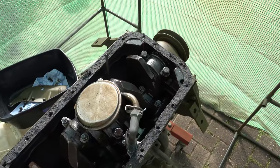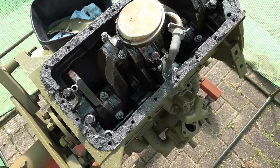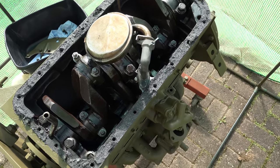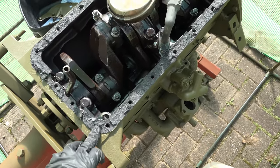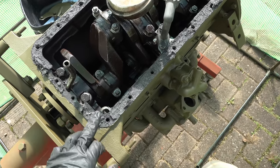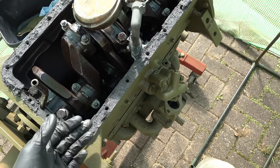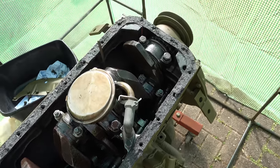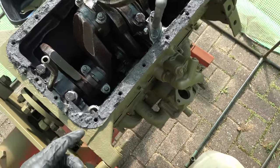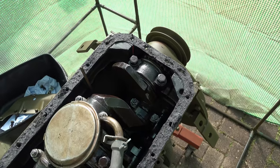It's hot in here today, hotter than it was a couple of days ago. We've got to keep this clean in here because this is all open - I don't want any dust or dirt getting in. I can't open the door, so I am going to get hot. Now, doing the sump was easy - it's all cleaned out. This is the difficult part. Obviously we can't use the wire wheel down here because this engine is complete and no bits can go in it. It's going to have to be scraper and acetone. Acetone is an amazing solvent for cleaning stuff - it eats plastic.